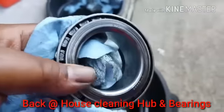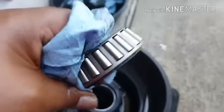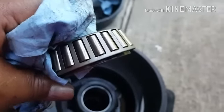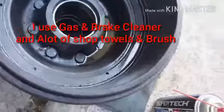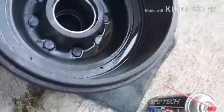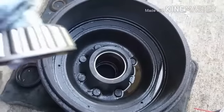What's up, fellas? Cleaning my bearings — they still good, man. Got some brake cleaner, cleaning them up, rinsing them out, getting the old oil out. Inspecting them real good, but they still good. So I'm going to slap them back in there. Money tight — I ain't buying new ones. I got some extra, but these still good. Cleaning up the axle — it's the hardest part. I'm going to put some rags in there. This thing was gooey. Get you some brake cleaner, spray it in there, get some good shop towels and clean it out real good. Inspect your races — I got to change one race. That's why I say inspect everything good. Put all your stuff back in good, make sure it's running. Maintenance, man — cleaning them back up to new-looking. Slap them back in.